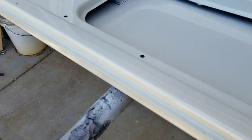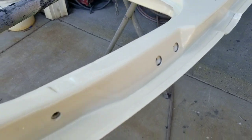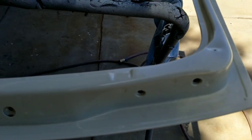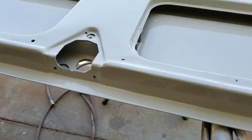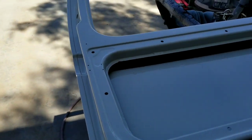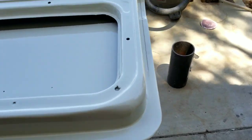It's all about getting that perfect time between coats. Some people say you feel the paint, touch it, and it's like touching tape. It's kind of like that. If you touch tape, say, right past where it's not smeary, that's way too early. Sometimes stringy is right on the edge, and with some clears you almost have to be on that edge to keep it right. So every clear is a little different.